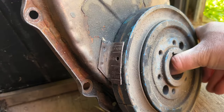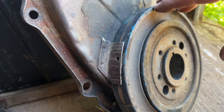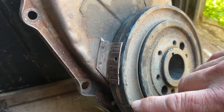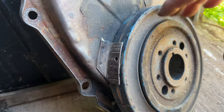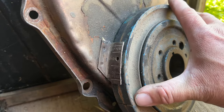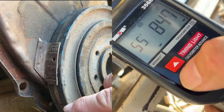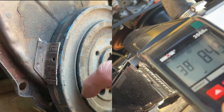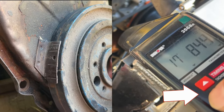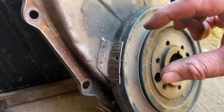With the digital timing light, it's a different approach. You're still using a strobing light, still looking at the number one spark plug wire, still hooking it up to the positive and negative side of the battery — only when the engine is running you have a digital screen. Let's say the engine is running at around 32 degrees total advance, at around 2,000 to 2,200 RPM — past the mechanical advance. The screen is gonna tell you a number, like 50 degrees, and let's say the timing mark is here while the light is flashing. Using the up and down arrows on the timing light, you press them to bring the timing mark on the harmonic balancer up to zero. Once you see the timing light flashing at zero, whatever the number is on your screen is your timing.